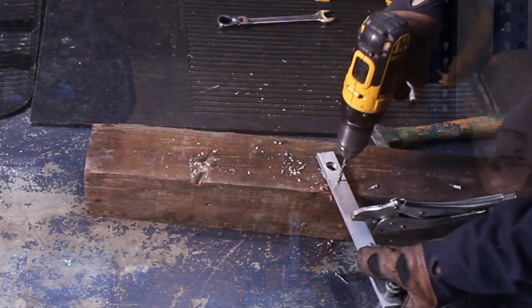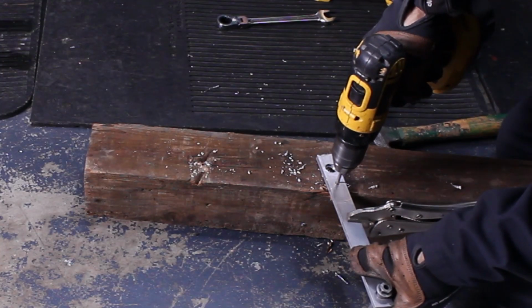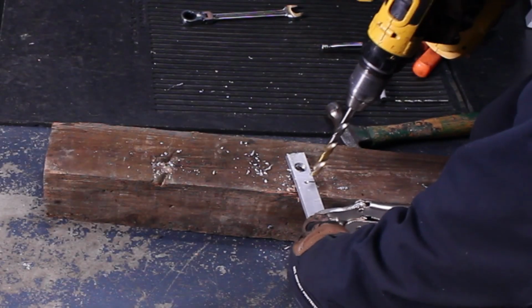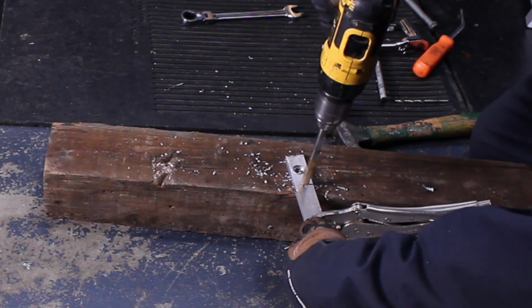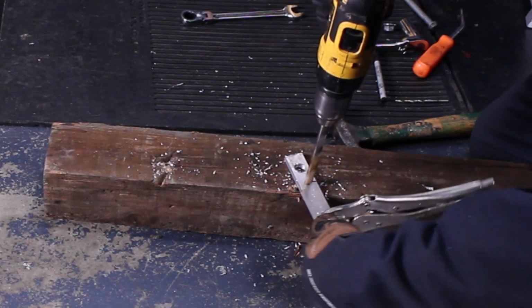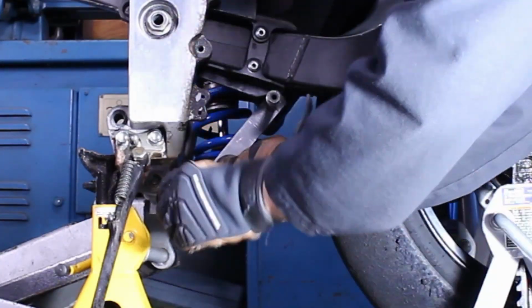Anyways, there were a few very good suggestions. And it seems like my problem is my dog bone. They're just the wrong length. Let's get to it. Okay, I'm going to shorten the mock-up dog bones by 2.5 centimeters to raise the rear of the bike. However, this will create another issue. The kickstand will be too short. We're going to have to deal with it another day.